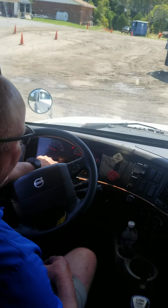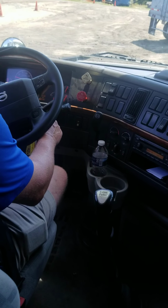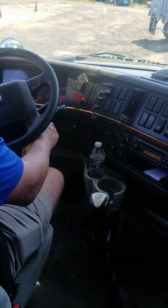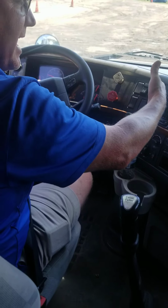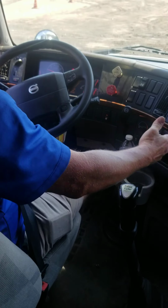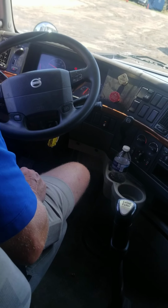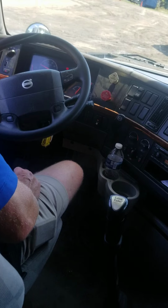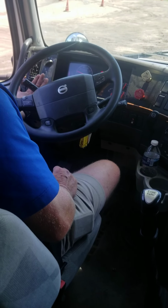In order to get to the voltmeter, you're going to push this ESC button twice. Alright? Everybody with me on that? Okay. So we continue to work our way on across this dash. There's nothing else that needs to be inspected right now. So we're going to drop down, come all the way back across. In this truck, just like the red truck, none of these buttons need to be concerned about on a pre-trip inspection. So I come to my steering column and start working my way up.